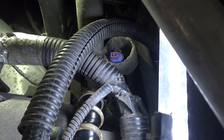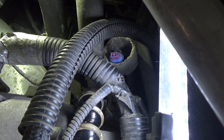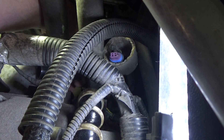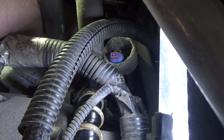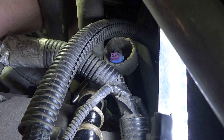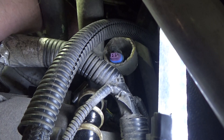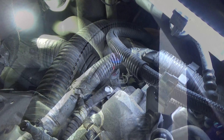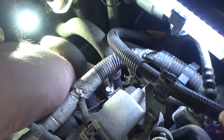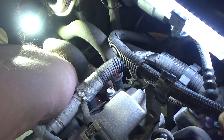On the new part, it was a three-quarter inch socket. So I've got a three-quarter inch deep well and a very short extension. I'm going to see if I can get that placed on there securely first — feel it right there. You probably can't see any of this, I realize. Get my ratchet positioned. Gently break it free. I can spin it by hand but I can't grab hold of it, so we're going to use the socket and extension. We definitely don't want to cross-thread it when we install it.